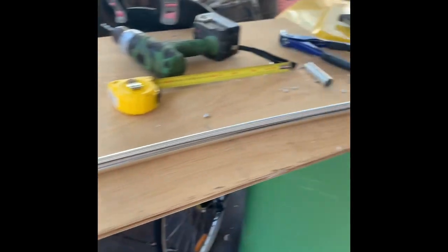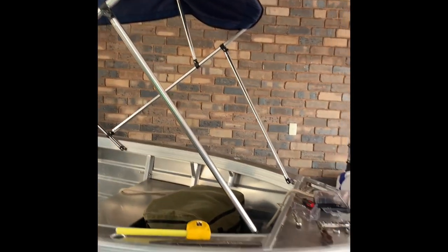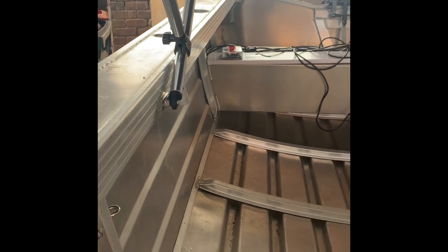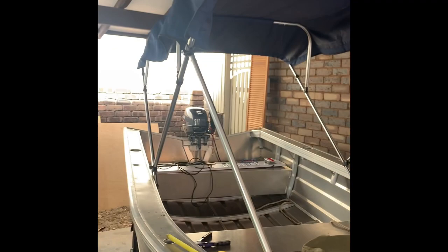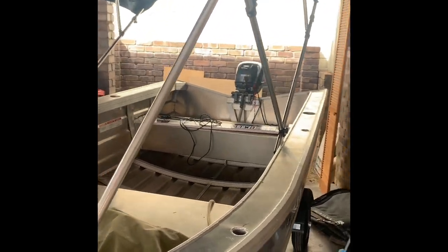Here I'm cutting the width of the canopy. I've now got the poles that fit inside the boat, so I've got the right width. I'm just about to put the straps on the back and tension them up. As you can see, everything is internal — it'll all fall inside the boat and be strapped to the back seat, designed so nothing sticks out on the gunnels and hits my roof.